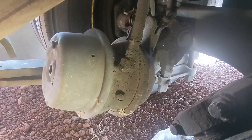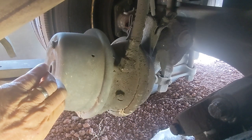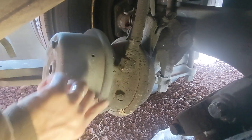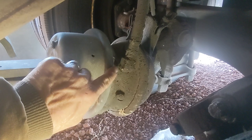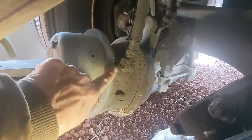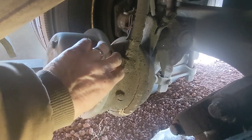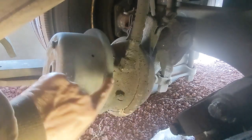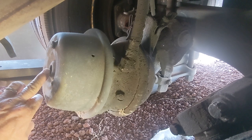Right now this bus doesn't run and we have to tow it, so we need to do what's called caging the brakes — pulling that shaft and the whole plunger assembly back against the spring. You cannot get in this side of the brake assembly; it's crimped on permanently on modern spring brake cylinders. On the old ones they had a band clamp on this side, and if you took that off there's enough force in that spring to potentially kill you. So now they crimp them on permanently. Be very careful if you're ever working on an old bus with two clamps — never take off the clamp on this side.